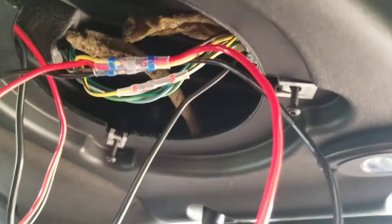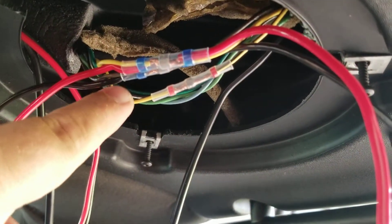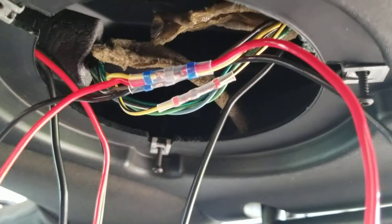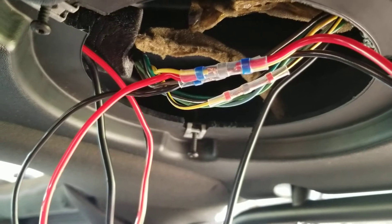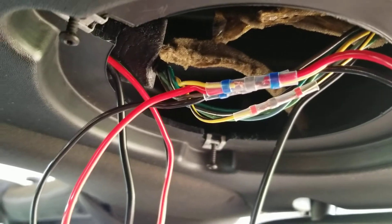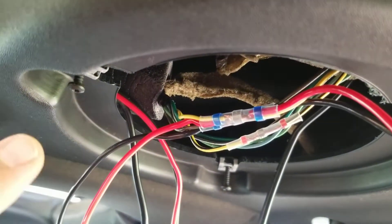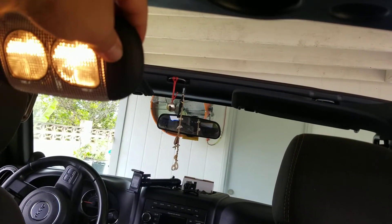The yellow wire and the yellow-and-black wire are power. The brown wire on your harness to your dome light is your ground. The solid yellow wire is the wire that supplies power when the door is opened. The yellow with the black stripe is the power that is supplied to the temporary on/off switch.